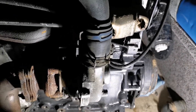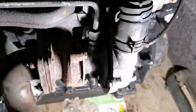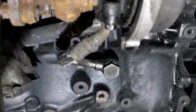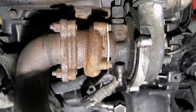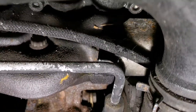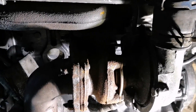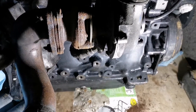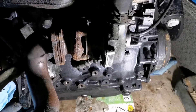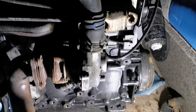In order to remove this turbo, I need to remove one of my favourite clamps — these bloody things here. As you've seen in previous videos, VW love using these things. We also have to remove the oil feed and the oil return down the bottom, and then there are two bolts there — they're multi-hex, 12-point. I'm hoping I have the right size socket for them. There is a nut on the far side. My heart sank when I saw the access at the back, thinking I'd have to take the intake manifold to get at it, but fortunately there's a nut facing down on that side, so it's not too bad. First I'm going to take off the oil feed and return pipes, take off that inlet pipe, and we'll go from there.